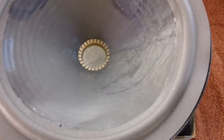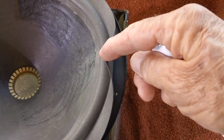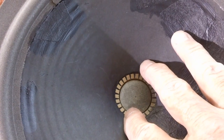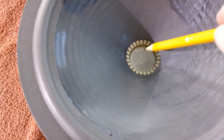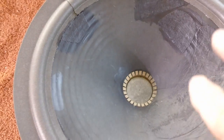It is the next day and we're getting ready now to cement down our surround. Normally with a new modern type speaker, you just kind of lift up the lip and glue it all the way around underneath, then press down slowly. Unfortunately I can't do that - there was so much voice coil rub here. If I just put a bead all the way around and started sticking it down, it would rub for sure. The use of shims doesn't help me either. I know some people say to use shims, and you can - sometimes but not always - because if I put those shims in there, glue it all the way around, then pull the shims out, there's no guarantee it won't rub. I have to feel my way around this thing.